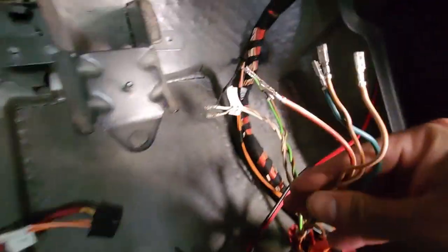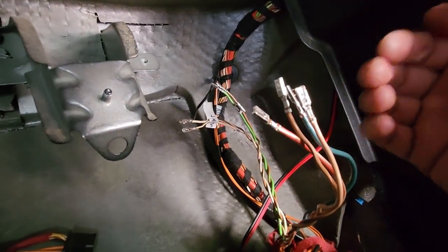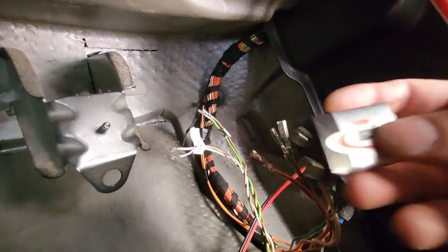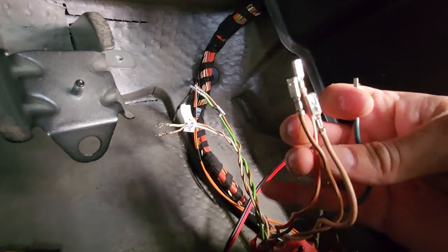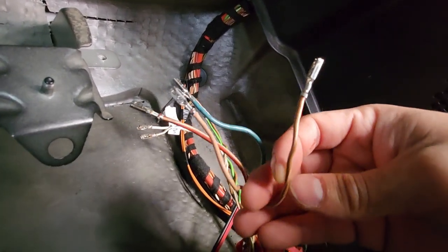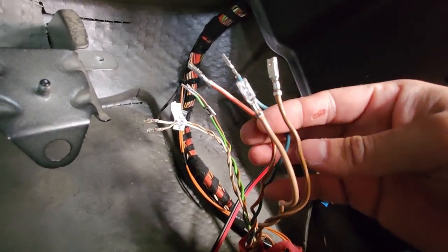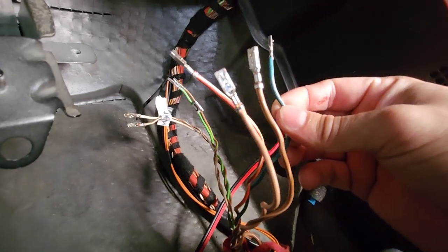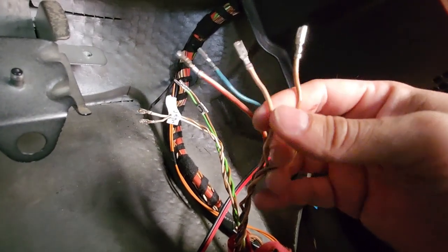Working at a very awkward angle is uncomfortable, but luckily with the seat removed I can get to this harness a little more easily. Using the battery method I'm able to pinpoint which one's positive - the one with the color and stripe is your positive lead, and the solid color is your negative. Same for this one. The thicker cables are for the woofer - the six and a half woofer going to the factory location on the driver's side, which is red and peach, then the bluish color. The positive lead for the three and a half is going to be brown with peach stripe, and peach brown for negative.